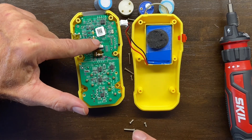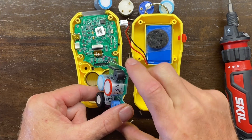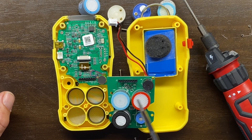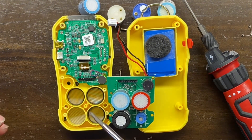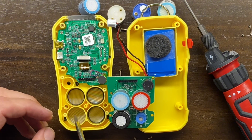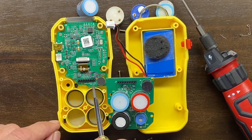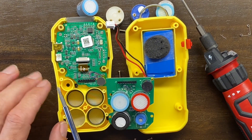Make sure you don't lose those little screws. With one finger, hold down the main motherboard while pulling the sensor motherboard very slowly, then unravel the sensor board. You'll see black O-rings that may be attached to the sensor — keep those in place. There is also a stainless steel mesh that helps prevent large particles from contaminating the sensors; make sure that is also in place. The sensor PCB is connected to the main PCB with a pin connector — do not damage it. Pull straight up.